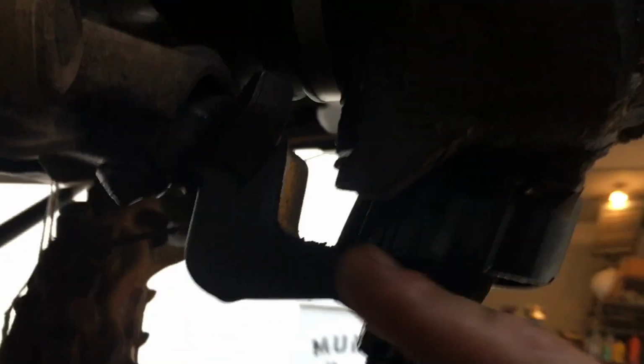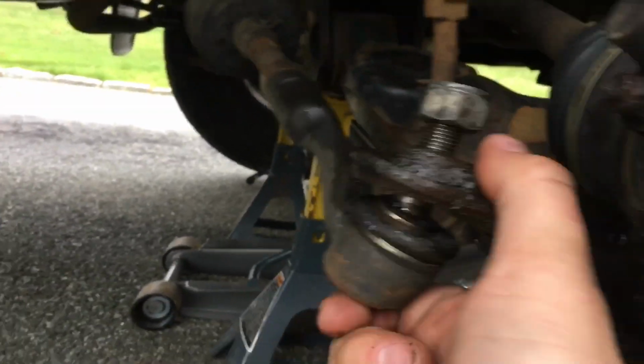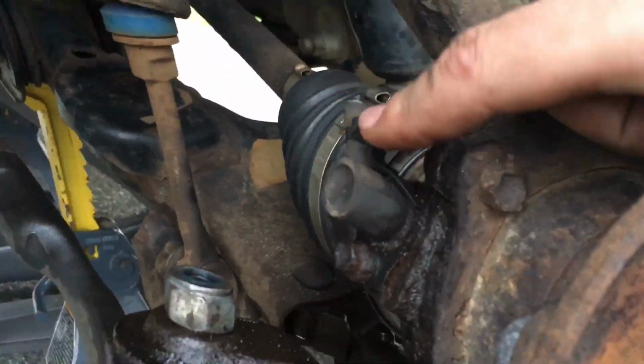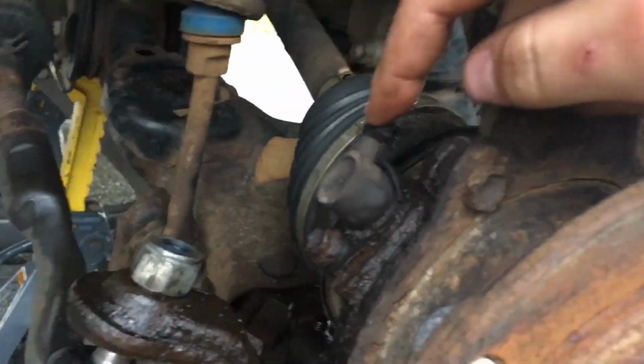And then I normally take these 4 bolts out. There's one here I already took out, and then one here that I already removed. But I normally take those 4 bolts out, and then those 4 bolts I loosen up. I stuck a pickle fork in there, smash it in, bang on the top with the hammer, pops right out. Top one, once you get this nut loose, you leave it on a few threads, and I took a 3-pound hammer and smacked the bottom of the control arm. Control arm comes up, and then the ABS sensor is a 10mm, and this whole ABS sensor comes out. Normally there's a cable, but I'm getting a new one, so I just cut it.